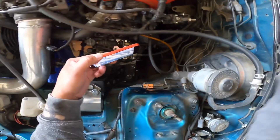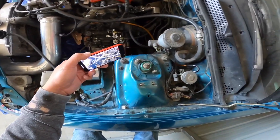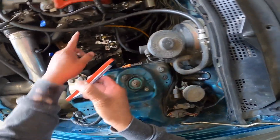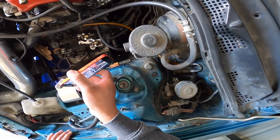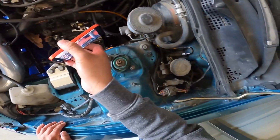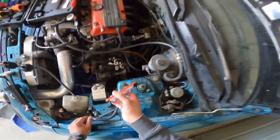Oh yes, yeah, you can see it right there — you're gonna see it dripping. So we need to pop this out, but first let me go see if Honda has that gasket in stock. We can go there and get it; if not we've got to order it. That's not too bad, it's an easy fix. I'm glad it's just that — I was starting to think it was a seep on the head gasket. I was talking to Andre about it and he basically said check that water neck. There's a ridge on the head that can leak from the front but it crawls all the way back. So yeah, it's probably this leaking — let's go ahead and get a gasket for it.